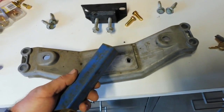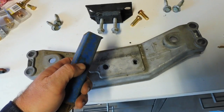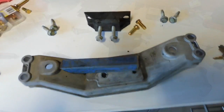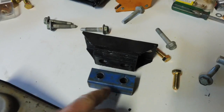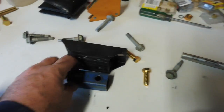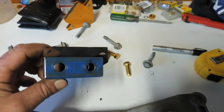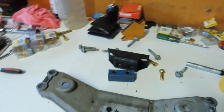So I don't think I'll bore you with the cutting of this down, so I'll cut all this up and drill some holes in it, and I'll come back so you can see the orientation of it. Okay, I cut that little bit of 30x30 down. I just held it up against the bottom of the mount, marked the centres, got the centre punch, punched it, pretty easy stuff. Put her over on the stepper drill on the drill press, drilled it out. Now I'm going to give it a bit of a paint with just some black kill rust paint.